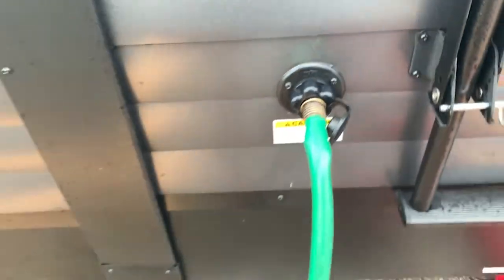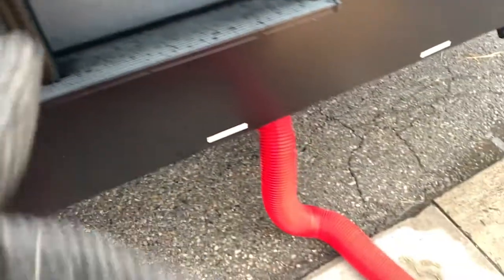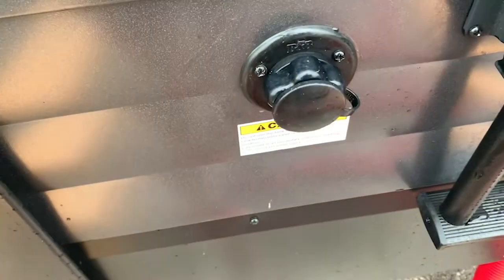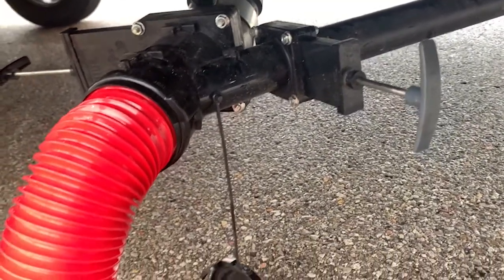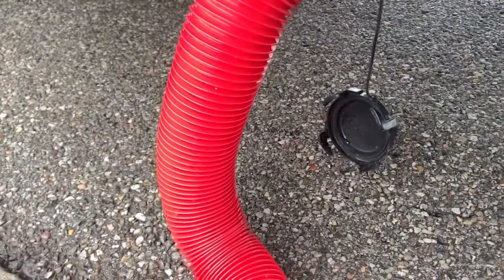Water's off, you can go ahead and disconnect it now, because you only use this for the black tank. This green hose is putting water into the black tank, so if you don't have the black tank lever pulled and you're filling it up with water, it will back up into the toilet, into the bathroom, and flood the camper — not good. So I've taken the green hose off. Once you're done with the black tank, we'll pull the gray tank lever. This gray tank back here is for the shower and the bathroom sink. We'll wait till that water is all gone, then clear the hose and move to the front.